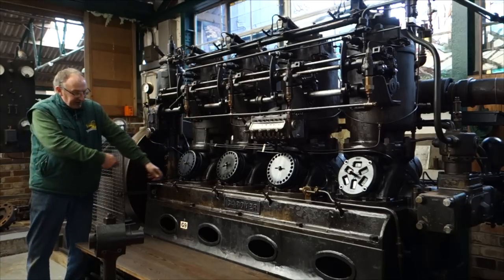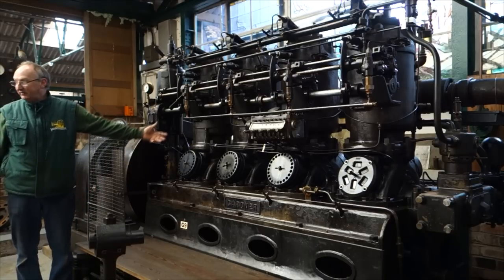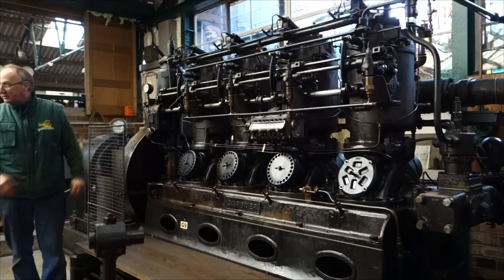Once it's started, I'll put it along and just drain any excess oil. If you didn't do that, it can effectively take the oil into the cylinder and run on its own oil, because it has just a ported two-stroke, so it's got a port in the cylinder.